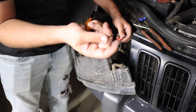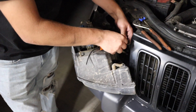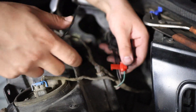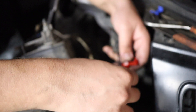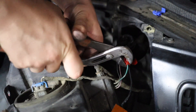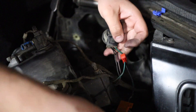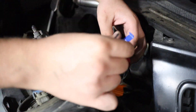I got these load resistors from Fly Right and I'll have everything linked down below in the description if you guys want to get these same ones. So I have the bulb here — I have the green wire — and I'm just going to take one end of the load resistor, put it in there, and we're going to crimp it. Boosted's tools are back home so I have to use these basic ones. Got it clamped down and then you just close that little clamp right there.